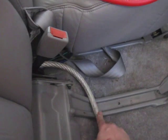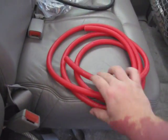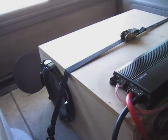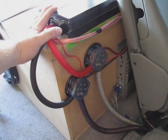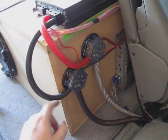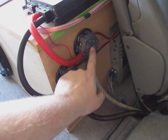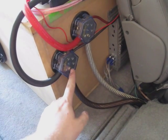It's stiff — it's not a flexy line. This stuff's the ultra-flex; you can bend it pretty easily, but it is true 0-gauge. I got that and a couple of connectors. And there's my box. On my Suburban I only had 4-gauge running from my power block up to the amp. With this flexy stuff it's a lot easier to get in there, so I just cut off a foot of it, ran it from my power up to there, cut off a foot of the black, and now I've got 0-gauge going to the amp. Hopefully that helps out. I didn't have to cut down the box or trim anything — they're just right by each other, so I've got good power transfer between the two.